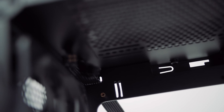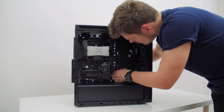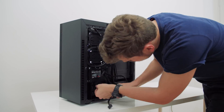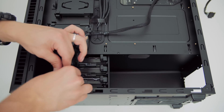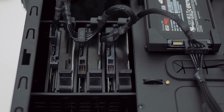For cable management, I would pre-wire the 8-pin cable and your I/O cables. Usually the 8-pin is in an awkward corner spot, and having that cable out there before inserting the motherboard makes it easier. Pre-wiring the I/O cables first before handling your power supply cables makes for a much easier cable management job. My main cable management tip is to route and assemble cables by areas and only then secure them — it allows you to visualize how cables spread through the back and bunch certain cables together by area. Remember that a standard SATA cable has four connections spaced out to allow four drives to be connected simultaneously if they're located one above another, so concentrate your drives in one area to avoid adding more SATA cables.